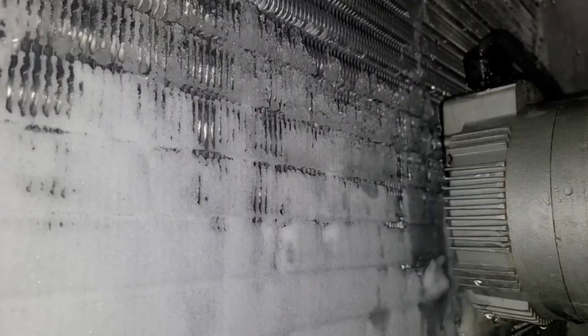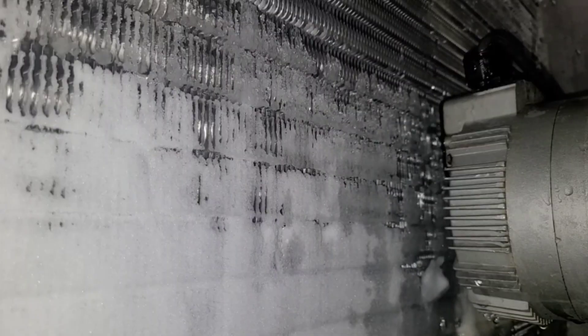In this case I was just making sure that the freezer circuit restarted. You want to make sure that it defrosts well — a follow-up visit a couple of days later to make sure it's defrosting properly and that the coil isn't froze up anymore. All of that is good practice and something we should be doing.